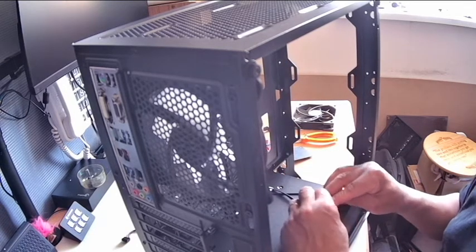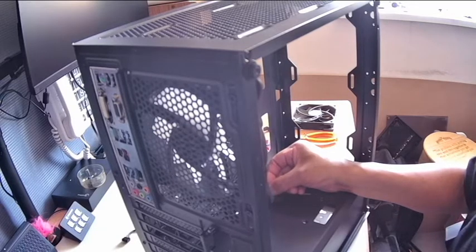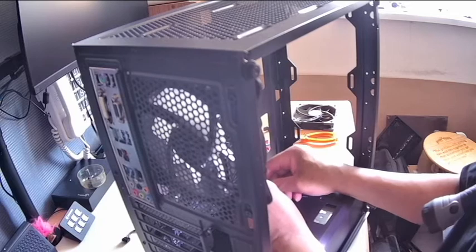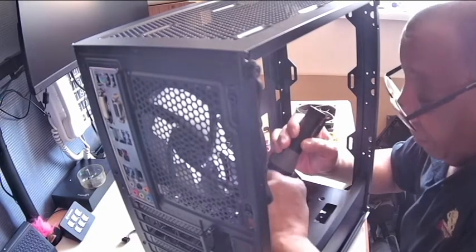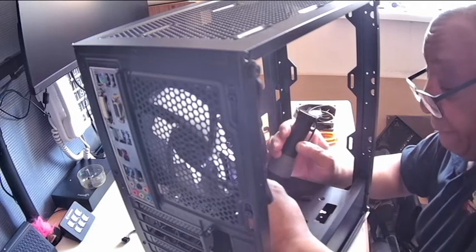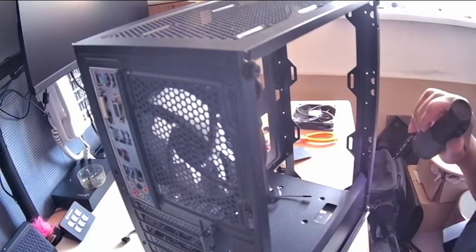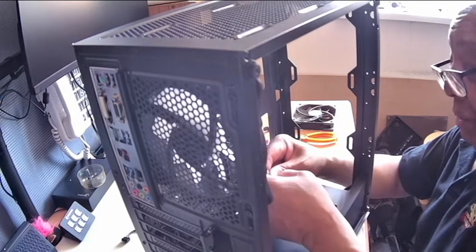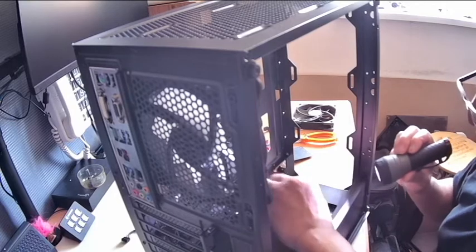And power switch. And that's the plus. We're just checking. Yes. Okay. We get in there. Right, and then what you want now is the power LED, plus towards the edge of the board again. So power LED, which is the one with the arrow. There we go. So let me just put that. It's so dark in here I can't see. Right, okay. So that's them wired up.